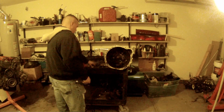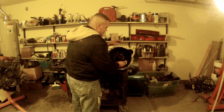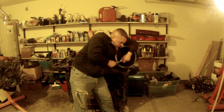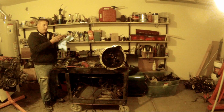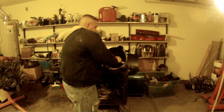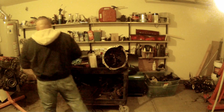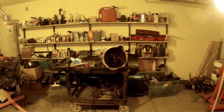Now that I got my bell housing from Bill, right now I'm just transferring over the bell housing onto this W58. It actually ends up being the wrong style W58. The guts and internals are perfect, except the shifter position is not long enough. So I ended up having to go out and buy another one, which is no big deal. I only spent $75 on this one, so it doesn't really matter to me. But the SC300 Lexus has the shifter about 10 or 11 inches farther back, so I went ahead and bought one of those.